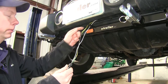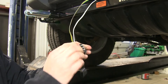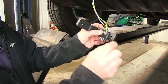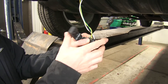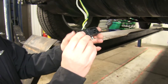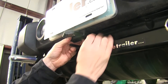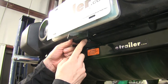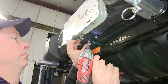Now I'll go ahead and mount the four-pole end to the bumper on the Jeep. We'll use the holder and the four-pole cover — we'll put the cover on first. The cover fits into a groove, so we'll put it onto one half, make sure the cover goes into the little groove made for it, and push it together and squeeze it. There are a couple of pins in there as a friction fit to help hold it in place. We'll take up some of the slack, put it where we want it. Just personal preference — you may want to put it off to one side or the other; in this case I'm putting it in the center. I'll take the long screws that come with it, run them through the oval slots and into the bumper. We'll need a Phillips-head screwdriver for this.